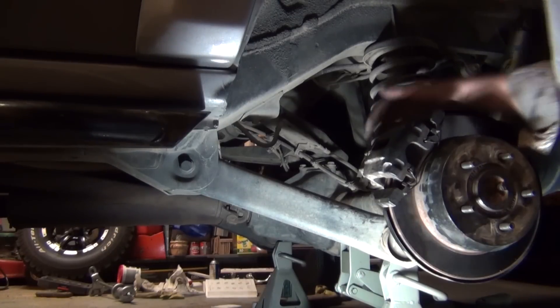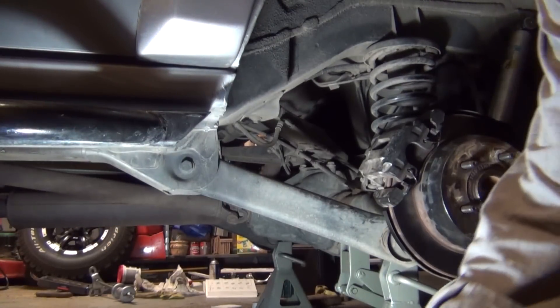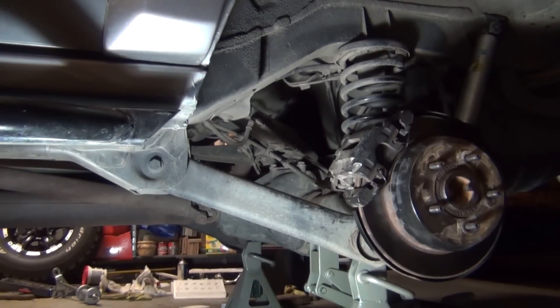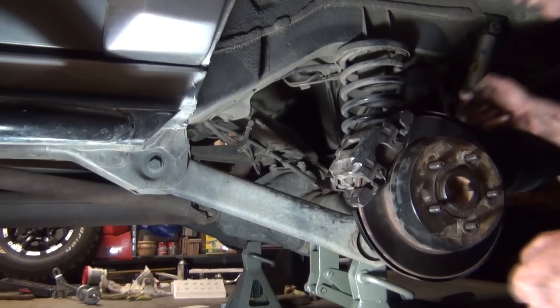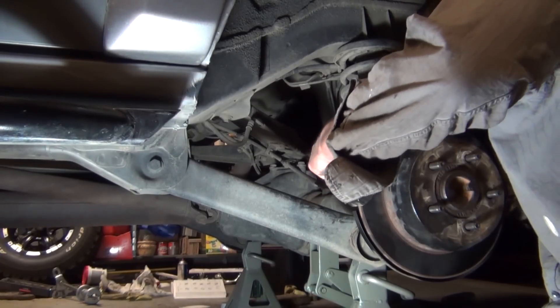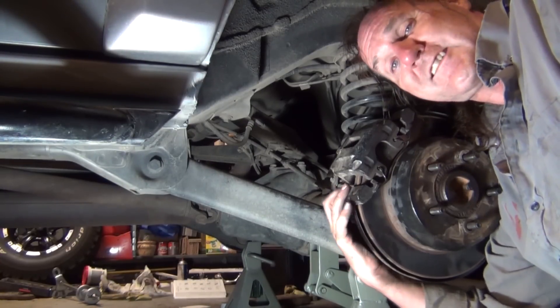When you get it there, don't let it go — I always snap my brake line and nobody would be happy about that. On the back side you've got these two huge bolts. I took them up to 85 foot-pounds because they were brakes.